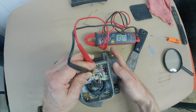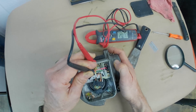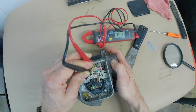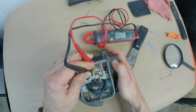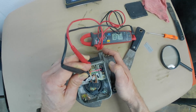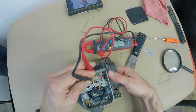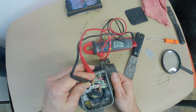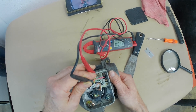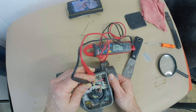Let me see if I can find it. It's not there — right here. See how the meter goes to open circuit? That's much less. The meter is kind of freaking out as it loses contact, and somewhere in this range at real light open throttle I'm getting wacky readings. The rest of the motion stays in the kilo-ohm setting. Everything works great until you get right about there — the readings don't seem consistent right about there. I'm not sure if it's just between segments or what.